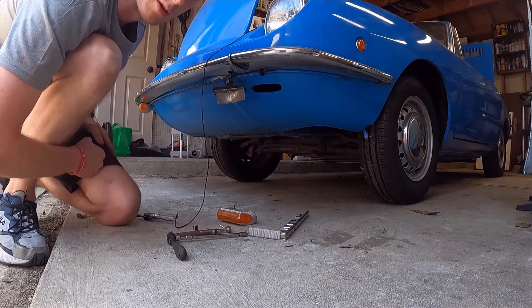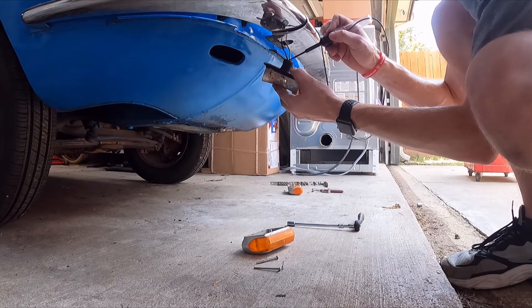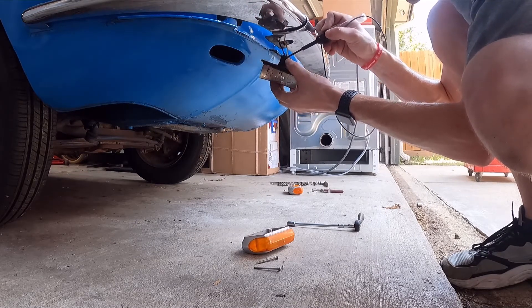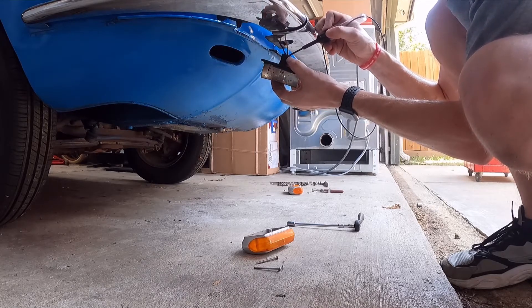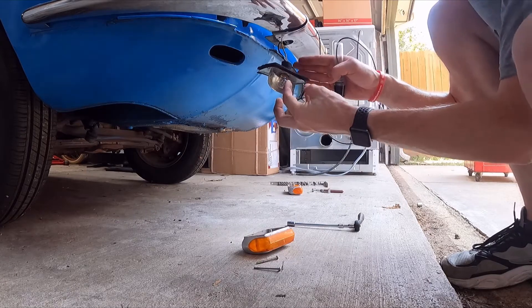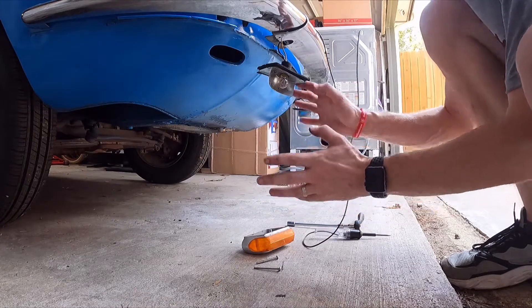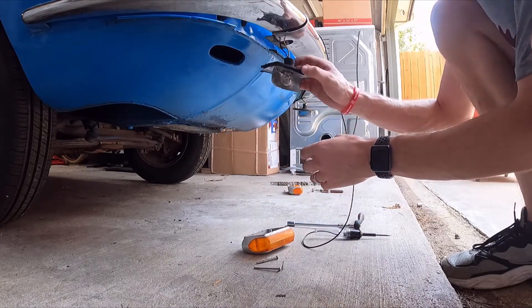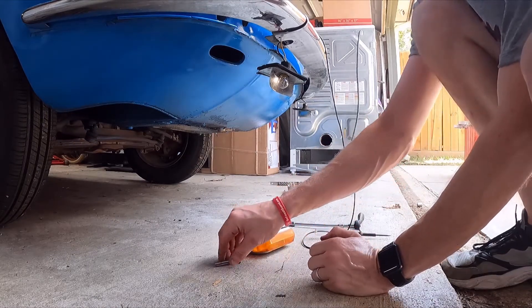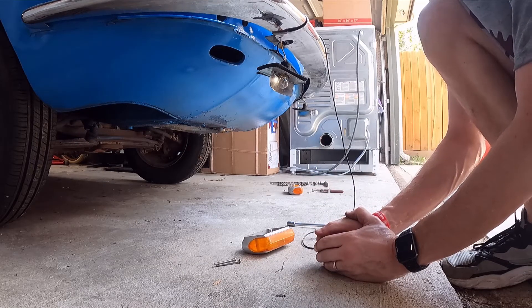So here we are on the passenger side. We're going to go with the same blue wire. Oh, we've got something — and there you go, now we've got blinkers. So that just means that we've got some grounds to clean up here, which is a really simple fix. We no longer have to chase a bunch of fuses and wires and run connection tests. We can get in there and clean that up with a Scotch-Brite or a small piece of sandpaper to get it all cleaned up. We can come back and test it again and hopefully that'll solve our problem.